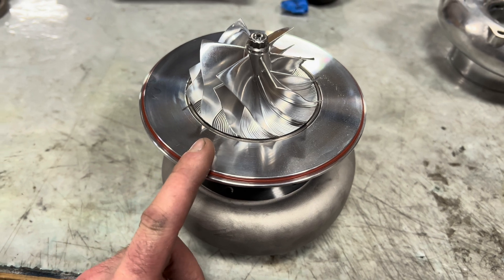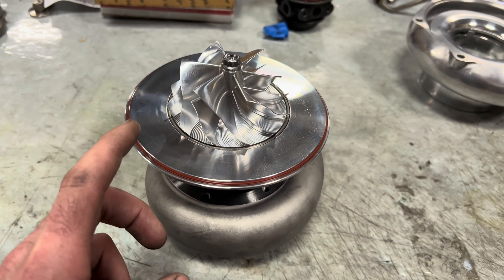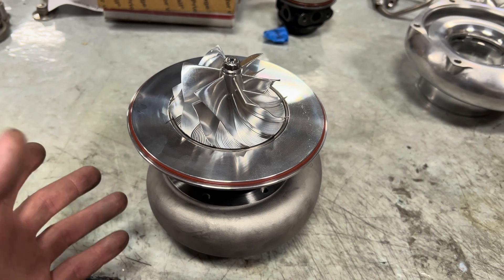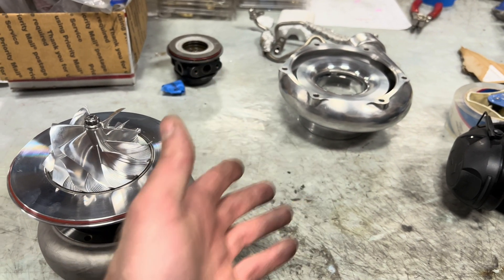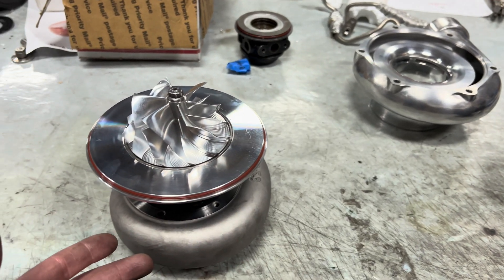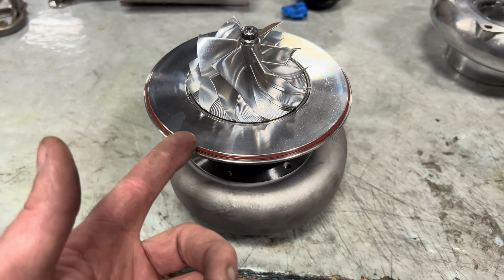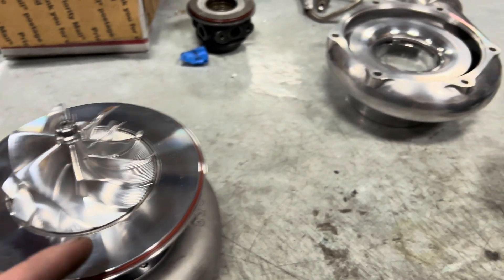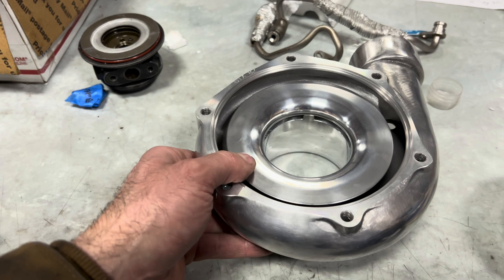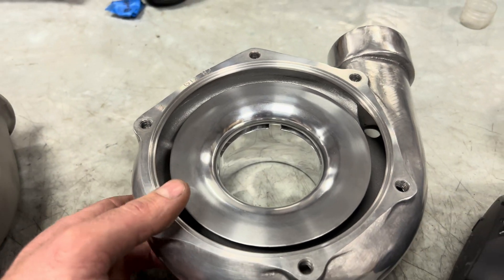These plates — I had these made. I'll link to those in the description box. I've got a couple pieces to be able to build these. Basically, I have everything to build the cartridges; I just don't have these housings, so I machine these. This plate is a TO4S plate. It's cut for an o-ring so that you can seal your TO4S plate to your TO4S compressor housing, which Garrett never did, which I think was a huge mistake.